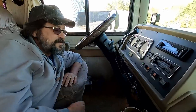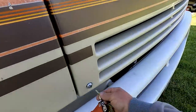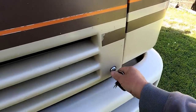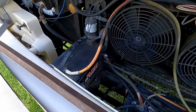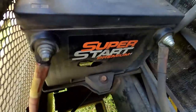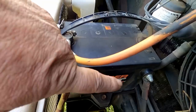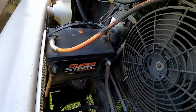I took a minute and looked that battery up on AutoZone and a couple of other places, price shopping. I think it's a group size 78 battery. The heaviest one you can get is about 800 cold cranking amps. This battery has the two side-post terminals but also the top-post terminals, which I'll need because of how this one is wired. I'll need a battery that has both the side terminals and the top terminal.